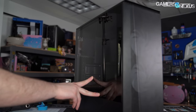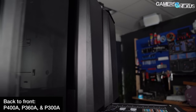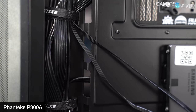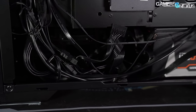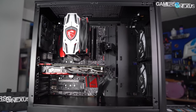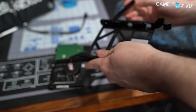Both panels are attached with captive thumbscrews at the rear. The front panel uses the same snaps seen for generations on Phanteks cases, but the metal posts of the P300A have been replaced with plastic ones here. The P300A and P360A are identical in width and nearly the same height, but the P360A is approximately 4.5 centimeters deeper. This means the hard drive cage doesn't conflict with the power supply mounting nearly as much, and maximum GPU length is increased up to 400mm when no fans are installed.